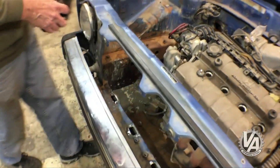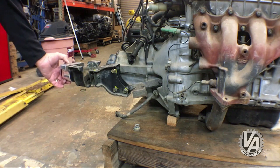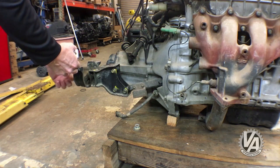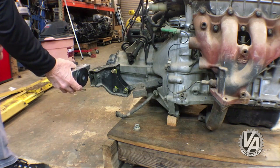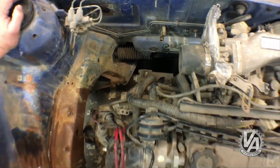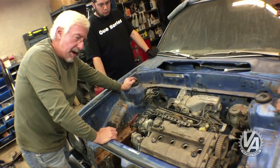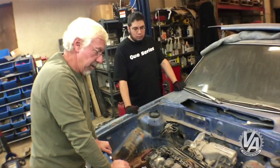On the other side, the front mount actually bolts to the transmission. We'll make something similar to the stock under-frame-rail mount we make for the '92 Civics, get it to mount under here, and make a bracket that comes forward and mounts right to that — that will be our transmission side mount. For the rear of the motor, there are a couple of bolt holes on the back of the transmission. I'm actually thinking about making a subframe for this car. If we can get good exhaust clearance, we'll fab up a subframe that will help strengthen the suspension, and we can put a mount on it at the same time. Sounds like a plan.